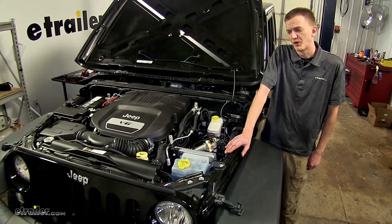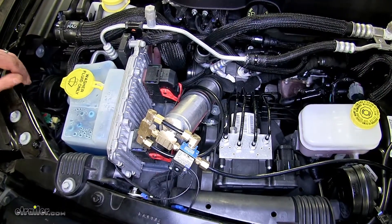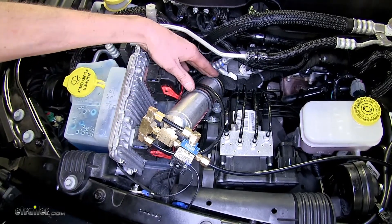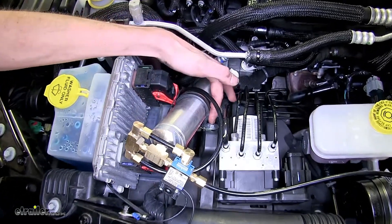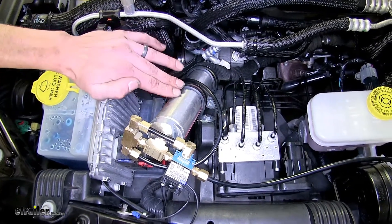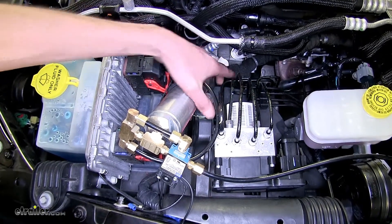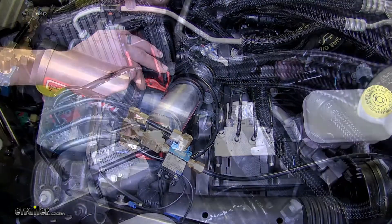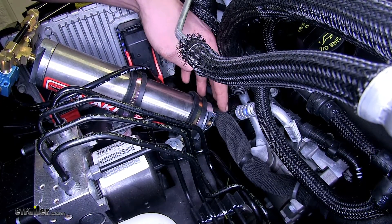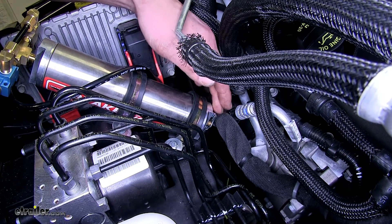The first thing we need to concern ourselves with is mounting our breakaway system. We did that with provided clamps and a couple bolts, washers, and nuts — though we used longer bolts to reach underneath the plastic panel to get a nut on. When mounting our breakaway cylinder, we need to make sure the bottom section faces downward somewhat, because it has a drain built into it.